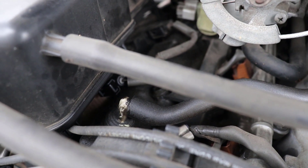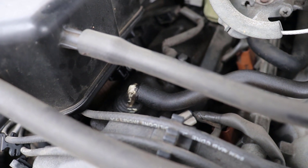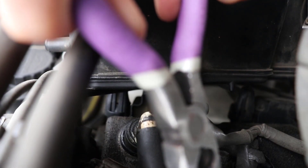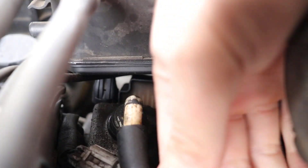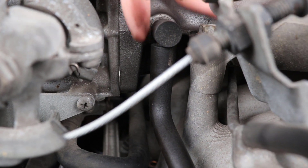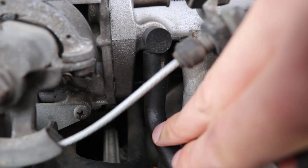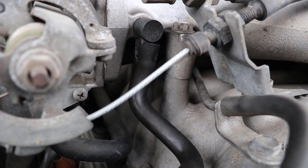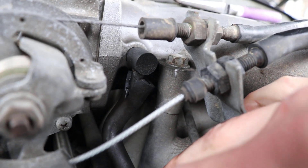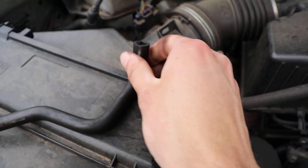Over the past few days, I have tried my best to spray this down with WD-40, in hopes that it will help to remove the valve a little bit easier. I'm going to try and do it by leaving this silencer box on for now, but we may need to remove it. Now that we've got the hose, the vacuum line off of the valve, this is where it connects to the actual intake manifold, so we'll pull this off. Since I don't really care about this hose anymore - we're not reusing it - it looks like it's tearing a good bit. It's very stiff, very brittle. You can see there's a crack in it, so we don't want to reuse that again.